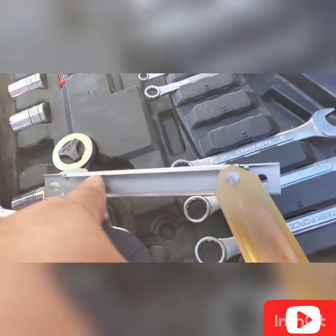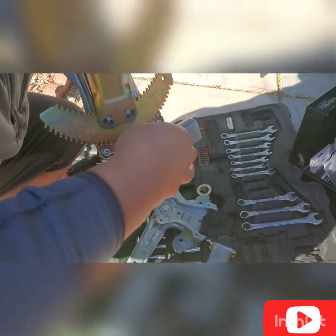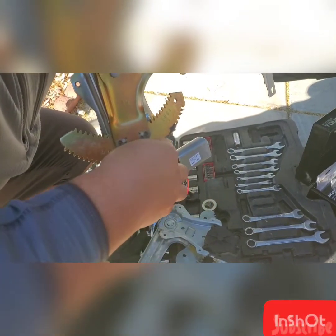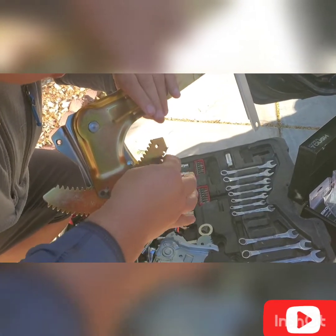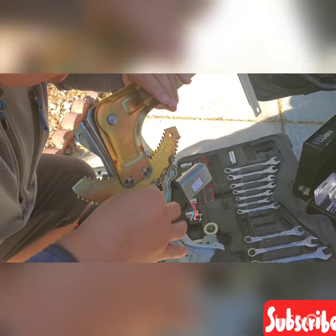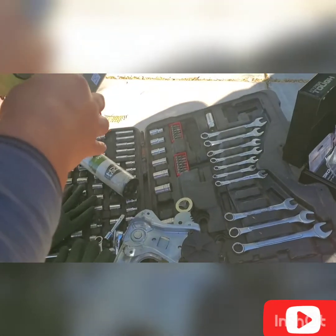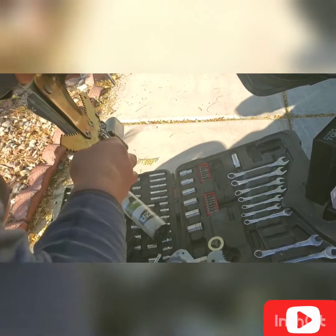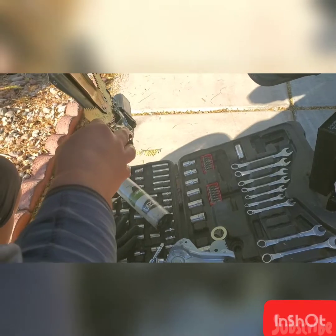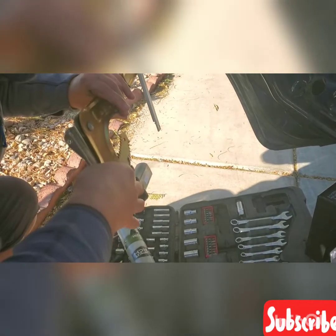This one, you need to put a grease through the rail and also to that as well. So don't rely on the grease that it comes with. I usually add the moly grease, which is a Super Tech brand, to lubricate it so that this automatic window regulator will slide through. Once you roll down, it will go down. Once you roll up, it's gonna easily roll up.